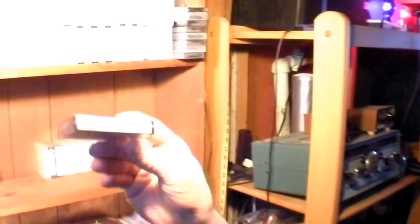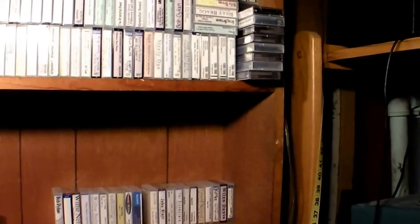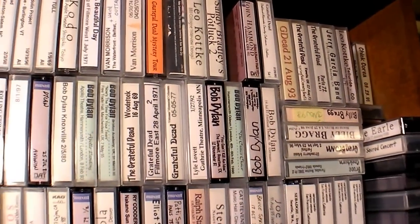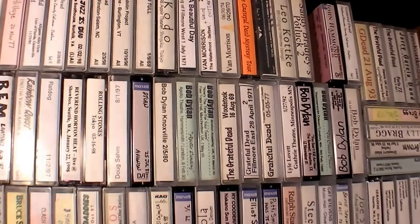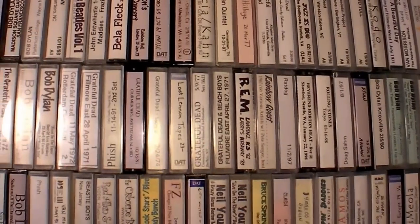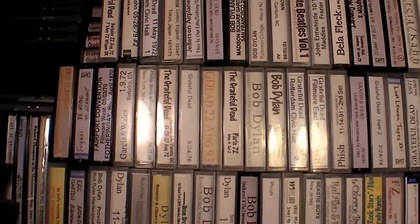Hi, this is my music archive. I'm making this video to demonstrate how I can move hundreds of thousands of hours of music on DAT tapes to FLAC files on my computer using DDS drives. These are DAT tapes — this one, for example, is Guided by Voices, a 180-minute DAT tape. The DAT medium appeared back in the 90s. It's a four-millimeter helical scan tape for digital music. Now in 2011, it's an obsolete medium and most people don't even have DAT decks to play these back.